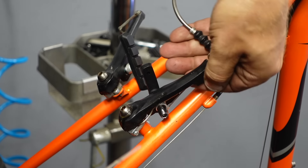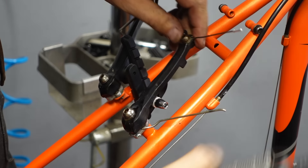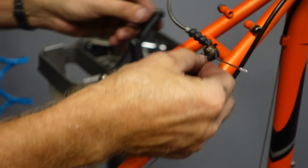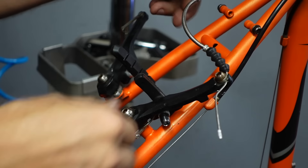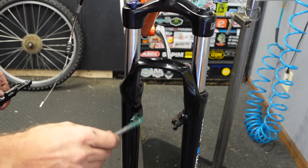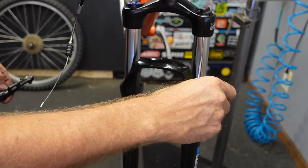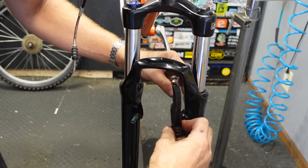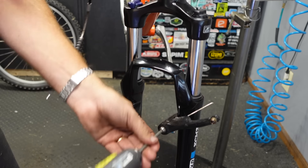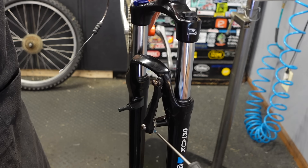Get back behind the springs too. I'll show you on this side where you can actually see it — get that cable out of the way and lube a little bit on that linear spring. That pretty much eliminates any chance of squeaking. For the front ones — off the bike — put some grease in there for the threads and inside the holes. The spring isn't really doing what I want it to do but there's a lot of thread on that adjuster, so we can work with that.